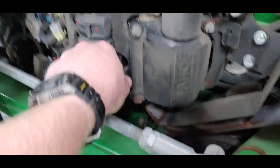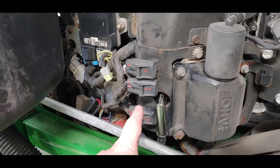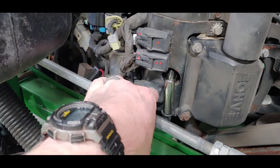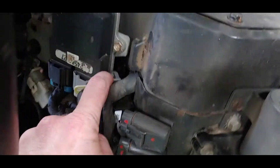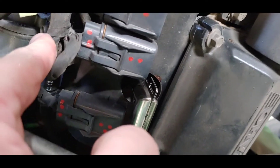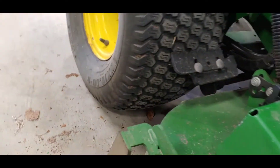Here's the Quick Track. You can see I've got a new boot here — this is the old assembly, this is the coil, so it's a complete assembly: coil with the boot. This is the side that had the wet plug. These are actually just fuses — there's a 10-amp in each of these and a 30-amp in this one. The coil is right here, and there's a plug on it, and one 8-millimeter bolt that holds it on.